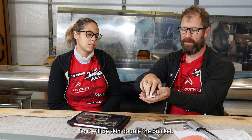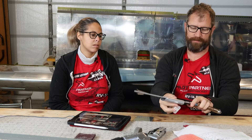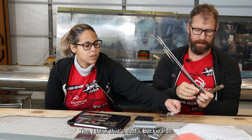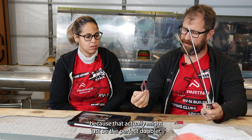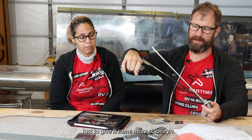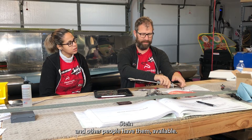The skin will have the hole cut through it, and the bracket comes with a template to help you cut. We might consider using that template as the doubler, though I do want the doubler to be a little wider for more stability. The bracket mounts inside the wing underneath the skin. There are instructions you can download from Garmin, Stein, and others — read them.